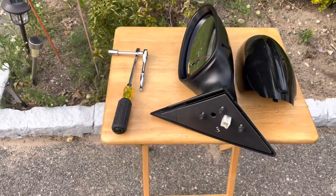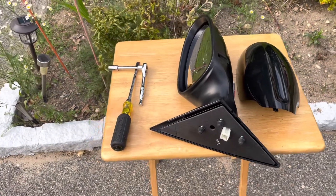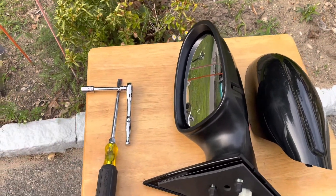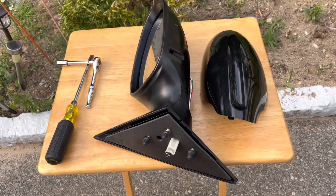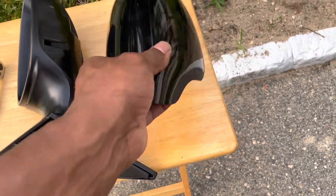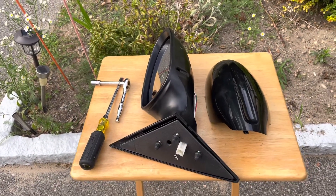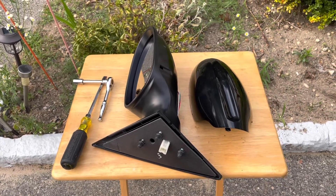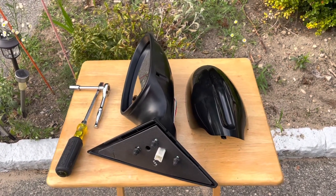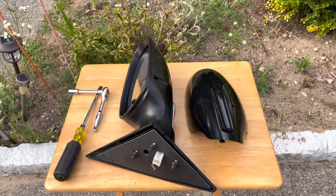The things you'll be needing today to install the side view mirror on this 2006 Nissan Altima: you'll need a flat-edge screwdriver, a 10-millimeter socket and wrench, and obviously the mirror itself. The mirror comes in two parts. I got this on eBay for four to five dollars — the dealers are selling it for like two hundred dollars or more.